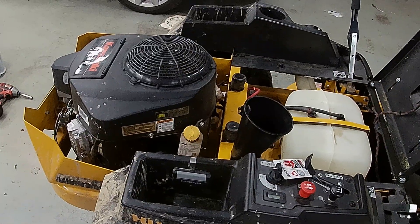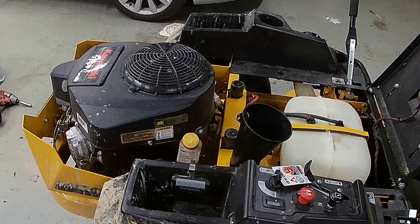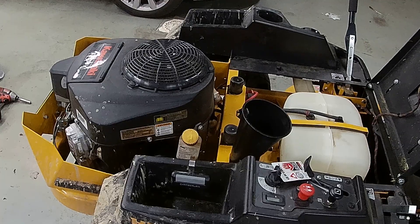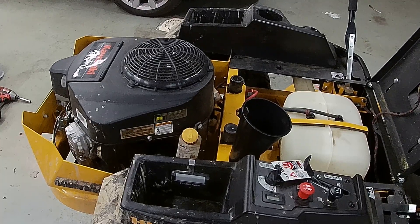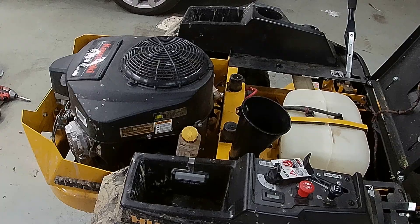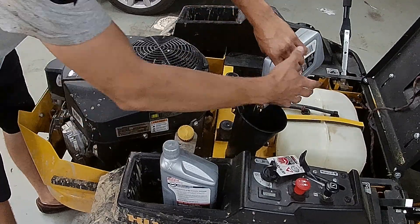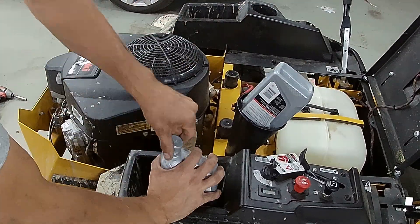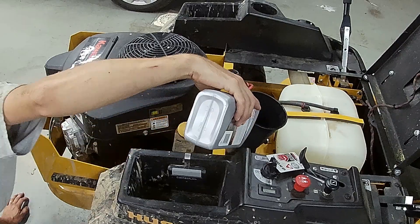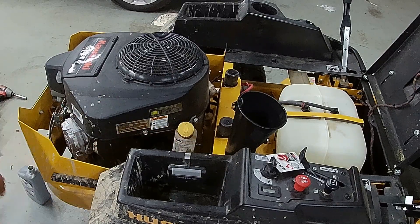Get your funnel into the fill port. You can do this one of a couple ways: either trust the manufacturer and put in what they tell you it needs, or you can do what I'm going to do — take out the side fill port plugs, which allows air to come out as you're filling, and fill it until a little bit of oil dribbles out, then throw the plug back in. Put your pan back underneath. This should take about two-point-some-odd quarts, so we're going to dump a quart in here — it should take two full quarts without issue. It's pouring out now.